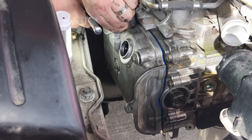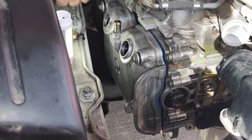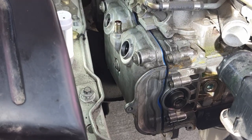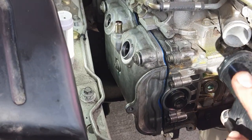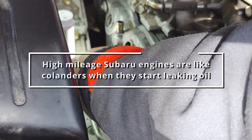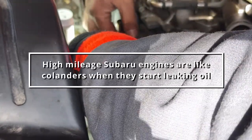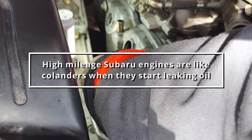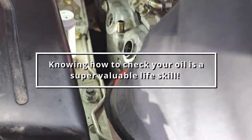And I'm going to make sure that it's seated properly on those rubber seals, because each of those seals is a place where an oil seep could begin, and we want to minimize that if possible, of course. Give it a little wiggle. Now I can see the top of the gasket starting to be drawn in, and I'm going to move down to the bottom.